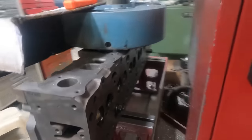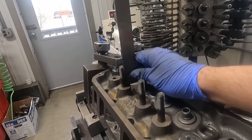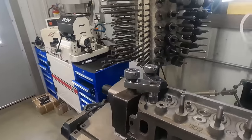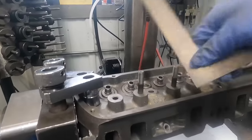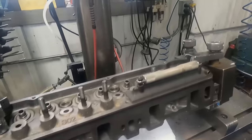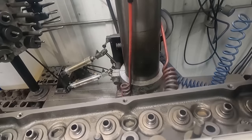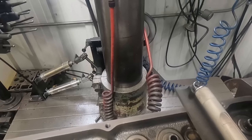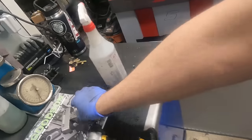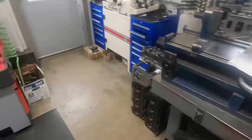Surfacing the manifold side on this John Deere. You can see that stud is square perpendicular to the valve cover face. So I'm basically just leveling up off the valve cover face to make it simple, as opposed to trying to use a level off of one of the other studs — it's going to be more accurate doing it this way.